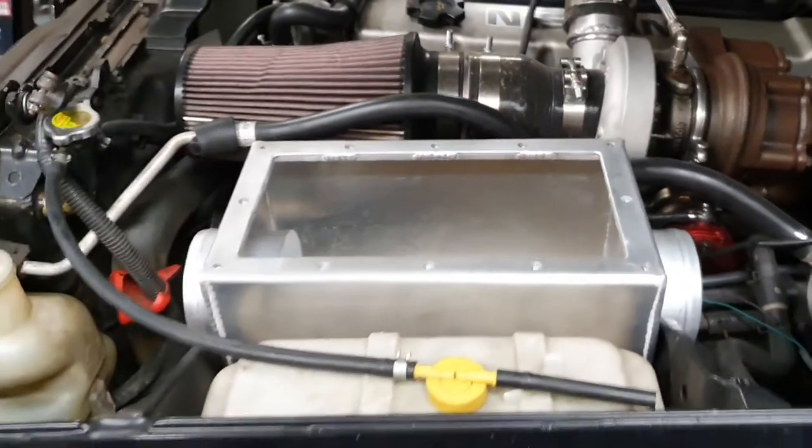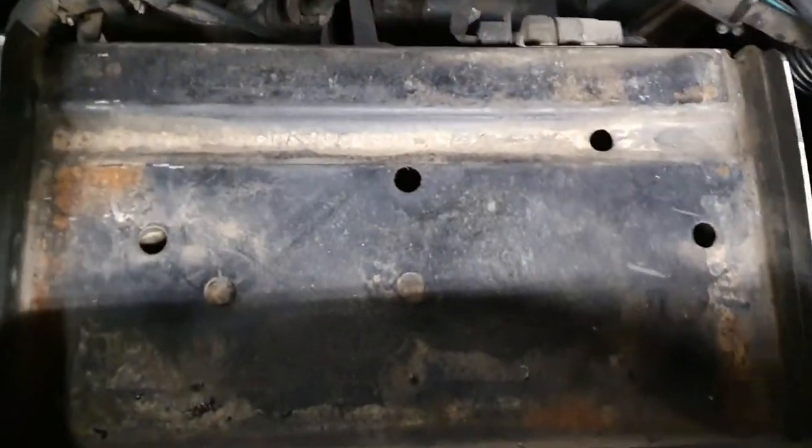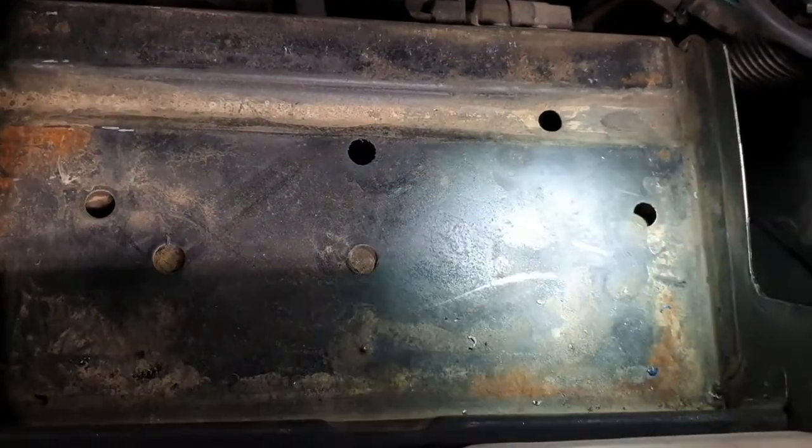None of these things ever just bolt together — they reckon they do, but they don't. There's a bit of a double-skin situation looking at that plate — riv-nuts through that could potentially be a problem. Looking at the other side — there are already some captivated nuts there, and being a four-wheel drive there's quite a lot of room. All I need to do is put that air filter box back in there and run a five-millimetre drill up through those M6 bolt holes, captivated nuts, then run a six from the other side without drilling the thread out. Put a bolt in, good as gold — using factory fittings. Done, bolted in.